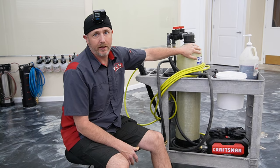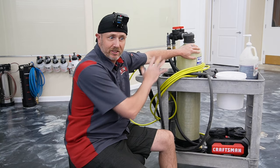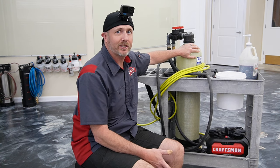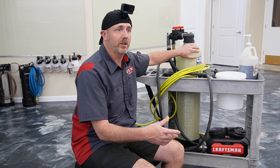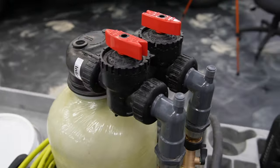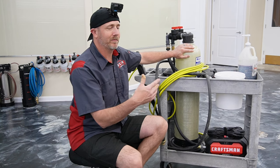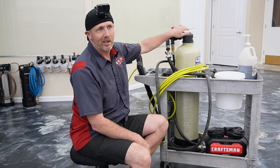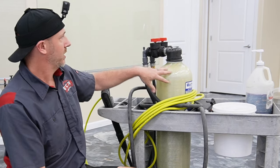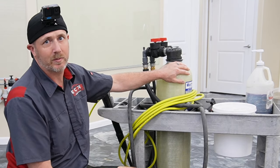The main component of the wash station is our wash pack. I'll put a link in the description to all the different products this incorporates. The wash pack removes the total dissolved solids, which keeps the vehicle from getting water spots if you leave any water behind. I definitely recommend the diverter valve on top so that you can bypass the tank if you're pressure washing something you're not concerned about water spots with — that way you're not wasting its lifespan. The contents inside are removable: the top comes off, you can dump the contents out, put new stuff in, and that rejuvenates it and basically starts its lifespan all over again.